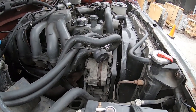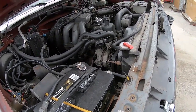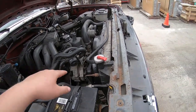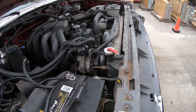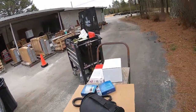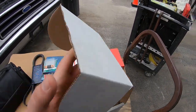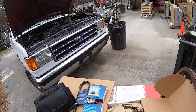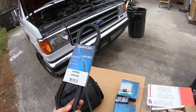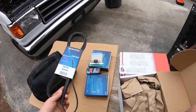I've been reading up on upgrading the alternator. Apparently it's a common swap on these old trucks. This is the old 2G Ford alternator - the 3G is the better, newer model, and that's what I went and bought. I also bought some other parts while I'm digging into it. I've got a squeak somewhere on the pulley system. I've already tried belt dressing and that didn't help, so I'm going to replace the serpentine belt while I'm at it.